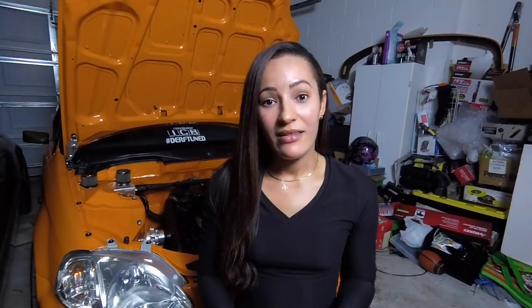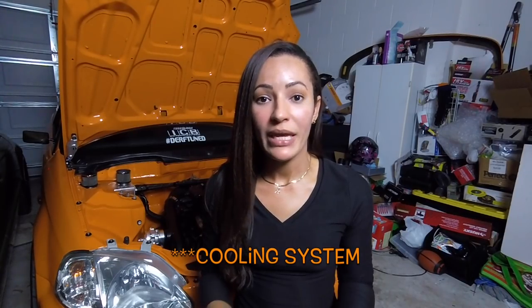Because it was losing coolant it started to get up higher and higher, but it would never go past 205, which is what my old radiator setup was consistently running at. I realized my radiator cap was leaking, and even after I bought a new cap it was still doing the same thing. I got worried and thought it could be my head gasket — last year I had pulled a head stud and that's exactly what happened. I was getting pressure in my coolant system, which was blowing past the radiator cap and filling up the coolant reservoir. So I pulled the cams and checked the torque on the head studs, which were fine. I wasn't having any telltale signs like a milky oil cap or traces of oil in the coolant, so I contacted KTUN and they decided to send me out a replacement upper portion of the filler neck.